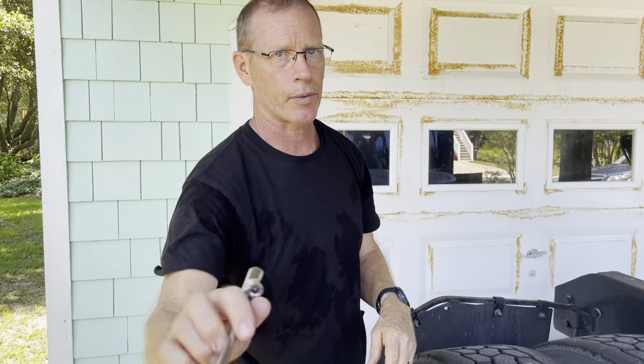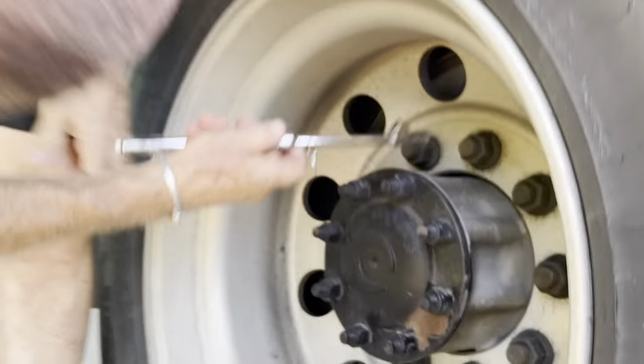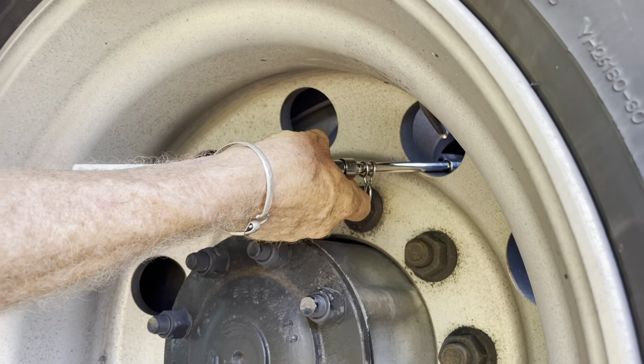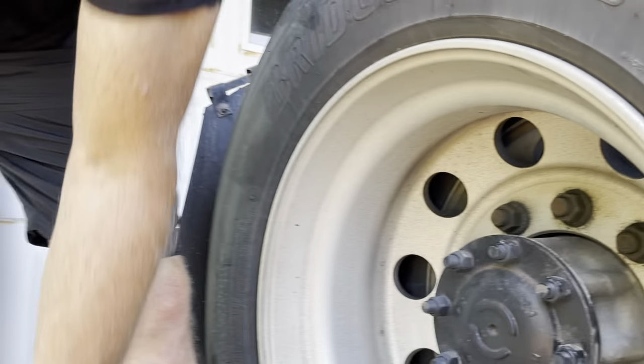In 3 minutes, let's see how far we got. All right, we're almost at 100 psi, after, like I said, three minutes. The compressor on the truck isn't heavy duty, it's not huge. There's tanks to reserve some of that compressed air. They're not that big. If you're at a truck stop, you'd have a system that's much more beefed up.